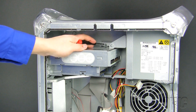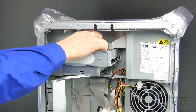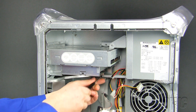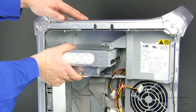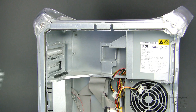Using your Phillips screwdriver, you will need to remove four screws, the first of which is located in the back and can be hard to reach. Now remove the Phillips screws here, as well as the one underneath the drive, and the one in the front of the drive carrier. Once all four Phillips screws have been removed, slide the drive carrier back and out of the Macintosh.